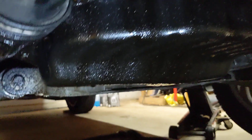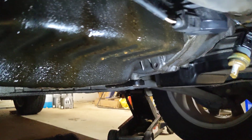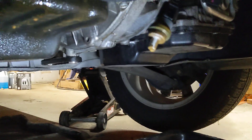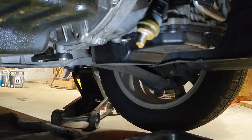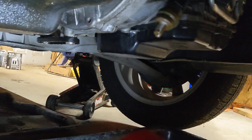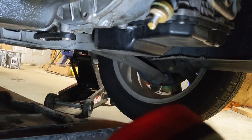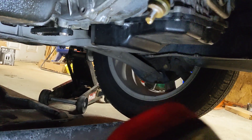When I pulled the belly pan off, this entire base is covered with oil, all the way over to right about where the bell housing is over there — there was oil kind of hanging off of that. I cleaned the bell housing off as a test because there's a weep hole in the bottom of the bell housing. I'm kind of assuming if the rear main is actually leaking, more oil will come out of that hole even as it's just sitting here, but I haven't seen anything come out of that hole yet.